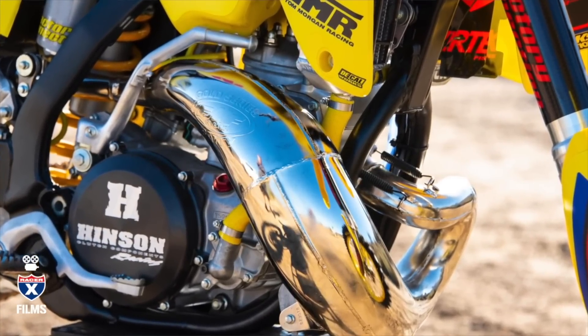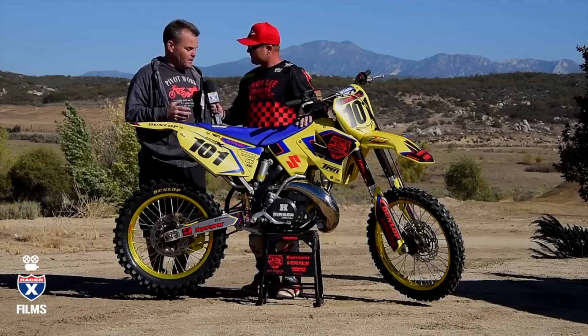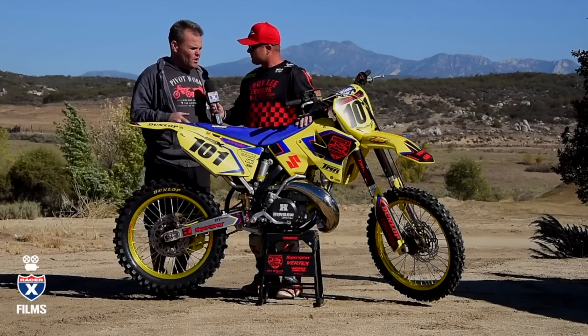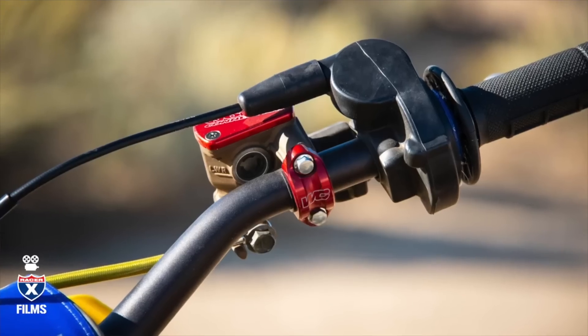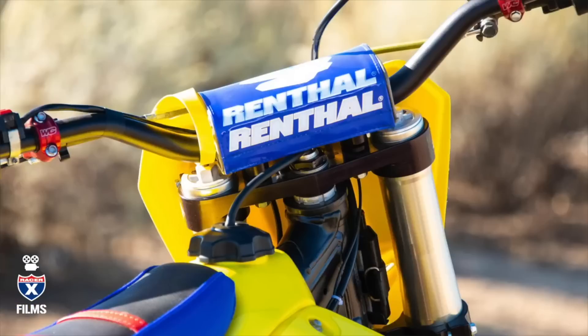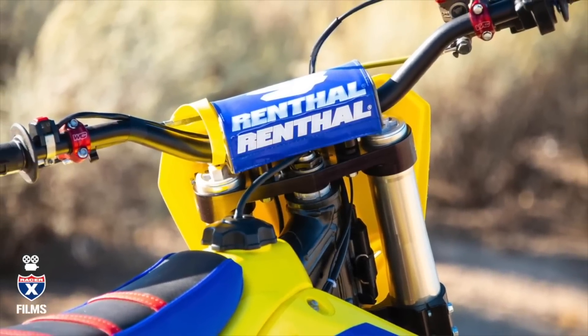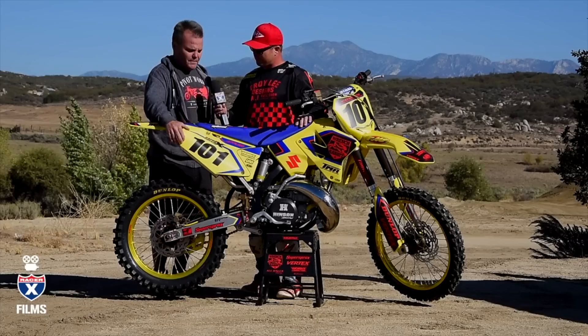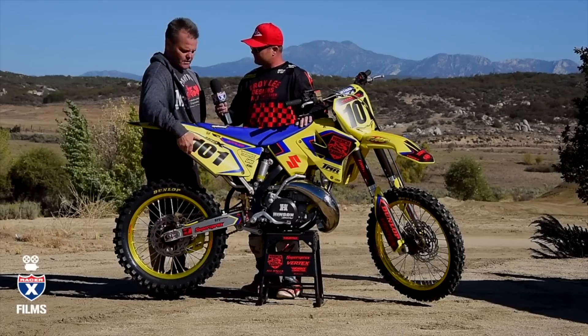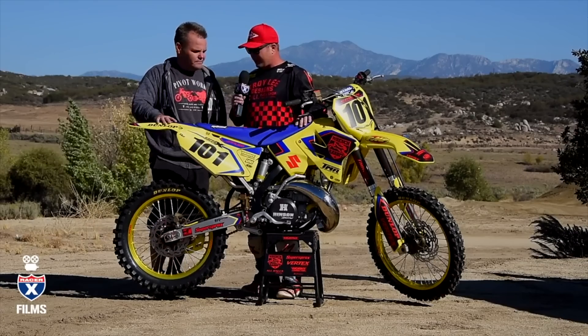While we were at it, we went in and greased everything. We didn't need to do too much on linkage bearings — just greased everything, it was still in pretty decent shape. We put new throttle cable, clutch cable, All Balls — got all that kind of stuff done. Applied made some custom clamps for us to fit the newer style front fender to give it a new look up front, and we cut the side plastics to give it a cool, updated look.